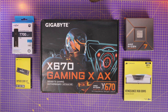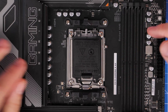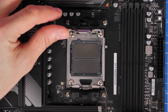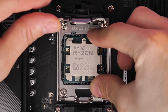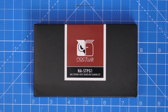Now I'm starting with the AM5 socket install with a Ryzen 7 processor on this Gigabyte motherboard. Obviously you have to install your CPU first — gently seat it down over the pins, taking care to be as gentle as possible so you don't bend any pins, because that will potentially damage the motherboard and render your computer inoperable. Then seat the latch back down and secure it into place.